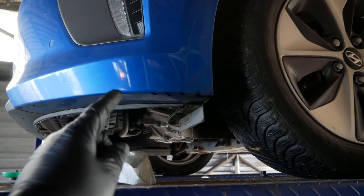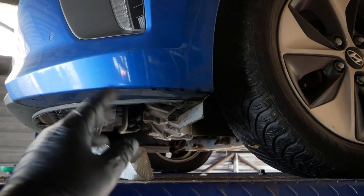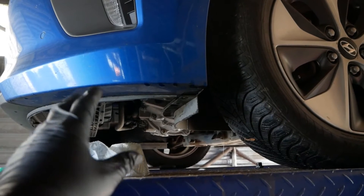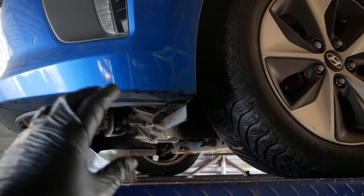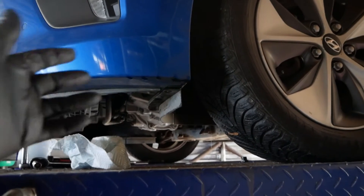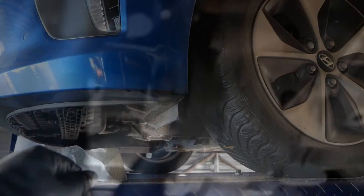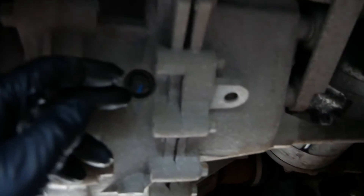I've found metal in quite a lot of oil changes, particularly on Nissans — Nissan Leafs and Nissan e-NV200s — I found quite big chunks of metal in the oil on those. On some EVs the reduction gearbox is the weak point, so leaving the oil for the lifetime of the car just isn't a good idea. Every 50, 60, 70,000 miles your EV is going to benefit from having that gear oil changed.